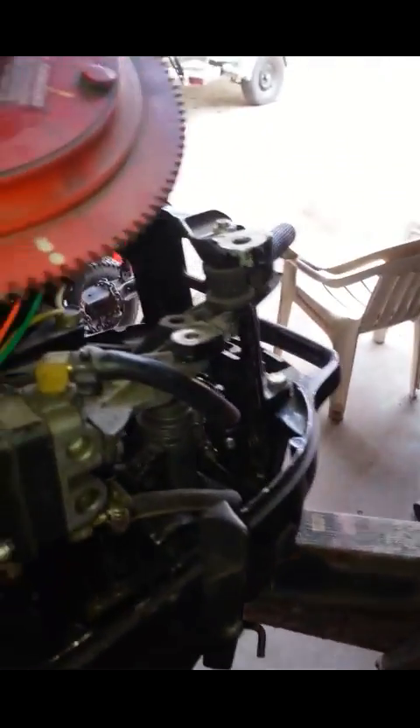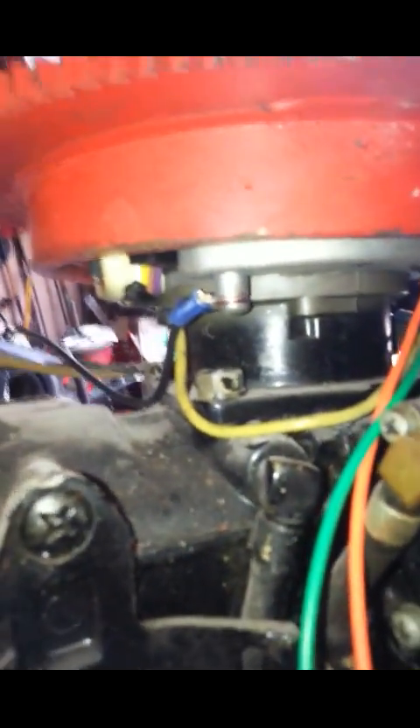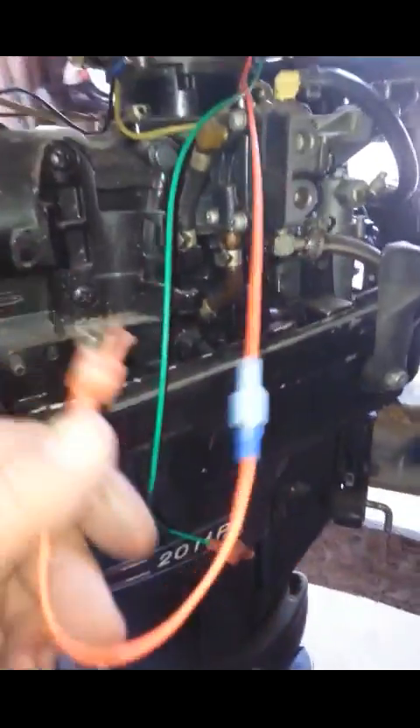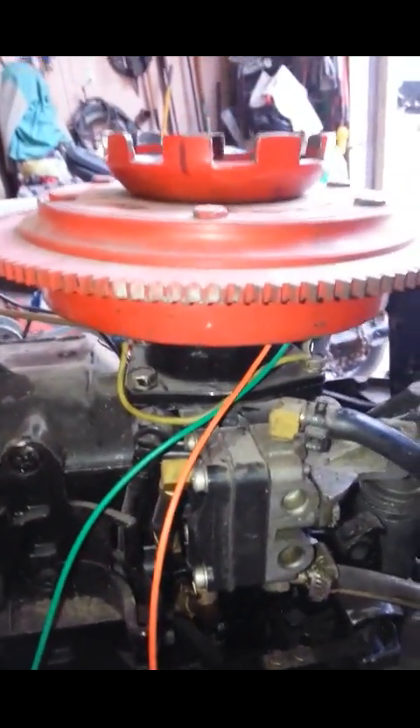Just so we can verify - see the splice, see how they're sitting. That's the stator, there's the numbers. I'm going to put the flywheel on it. Just so everybody knows, that is a CDI stator that came back to us saying they did not find a problem with it. If you look at their manual on this motor, this here is grounded out. So when you take ground away from it, it's supposed to kill the stator. This wire here goes to the coil.